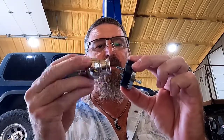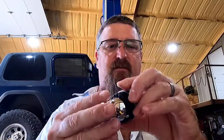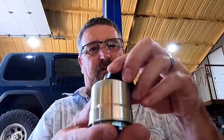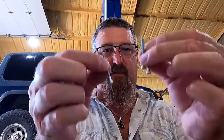These spherical bearings from Iron Rock Off-Road work by getting rid of the rubber. You put this little phenolic spacer on there - they say it's urethane but it's not - and this ball will pivot in here instead of stressing the rubber. Here's the sleeve and the cup. This will go in on top of the axle, then this goes in on the other side, and you put this cap back on. You've got these little cap screws that you bolt it together with.